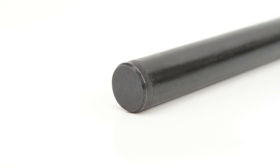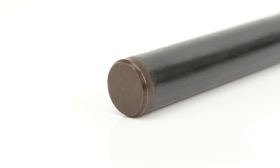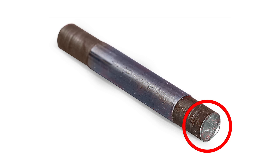If you are using a high pressure or high volume fuel pump with a cast iron cam, you will need to upgrade to bronze tipped rods. Performance fuel pumps exert more pressure on the pushrod, which in turn presses harder against the camshaft fuel pump lobe. The bronze tip adds a protective cushion, but it will need to be checked periodically to ensure the bronze tip has not been worn off, thereby leaving exposed steel rubbing on the lobe.